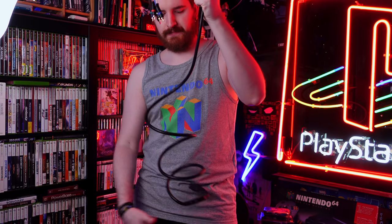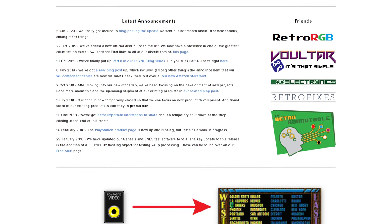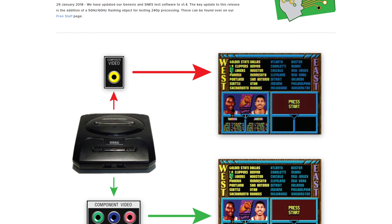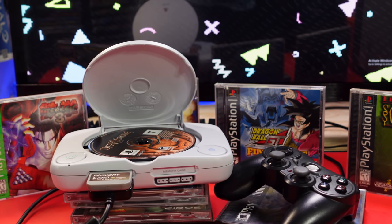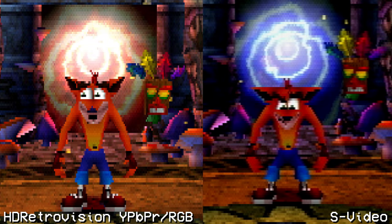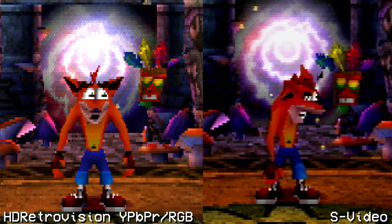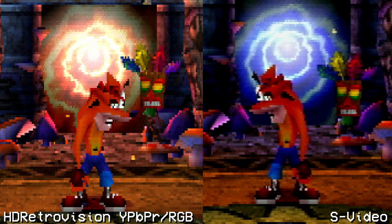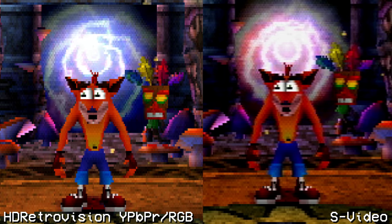You can go even further — for a lot of consoles, there are component cables from a company called HD RetroVision. They have very finely tuned, engineered-for-specific-consoles component cables that get the best possible signal, bypassing the composite and S-video options entirely on some systems, such as the PS1. Using the Genesis component cable plus the PS1 adapter on the PS1 bypasses composite and S-video to get RGB, which is a lot cleaner with each channel separated for a much sharper image. They're expensive, but I recommend going with S-video cables and the RetroTINK 2X now, then upgrading to HD RetroVision cables later. This is not sponsored — I just insanely strongly recommend picking up a RetroTINK device because it will make your life a lot easier.